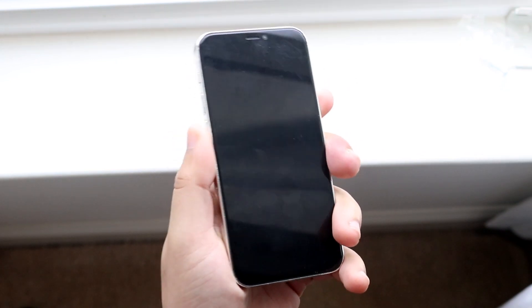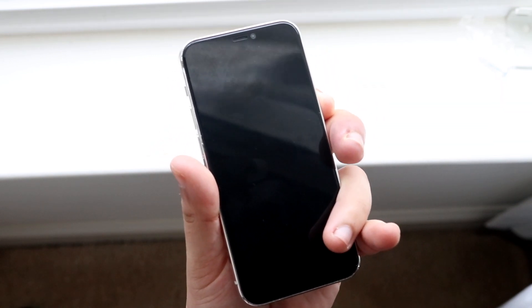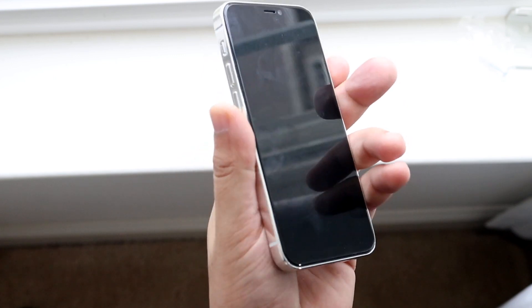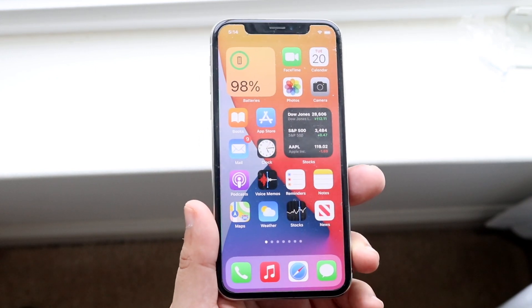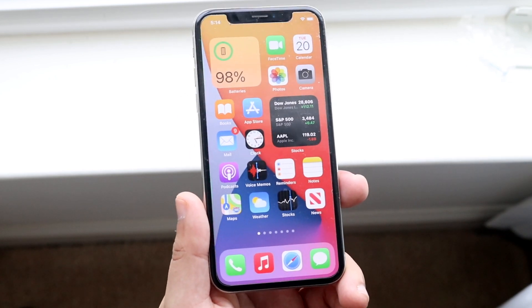I have a completely fake iPhone here — it's not a real iPhone 12 mini — but basically click up, click down, and hold down that side button. Eventually the iPhone should boot up, and it will probably take a minute or two. Volume up, volume down, hold the side button, and your iPhone will either reboot into its software or prompt you to plug it into iTunes to do a backup, and from there you can connect to your computer and go from there.